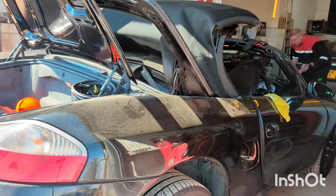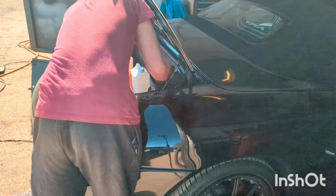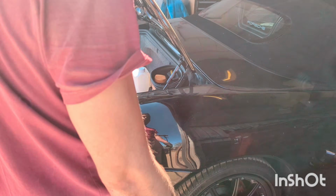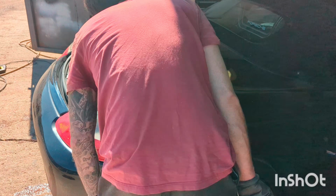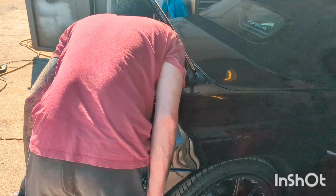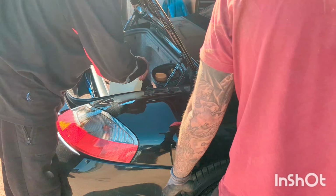So here we are working our way through the bleed procedure. The car's taking quite a long time to get up to temperature and then respond accordingly. We'll include a bit more detail very shortly on what's going on here. But ultimately, we're trying to get it to run up, run the thermostat, drink more of the coolant and burp itself.